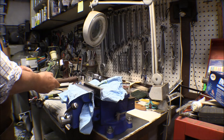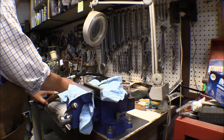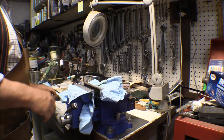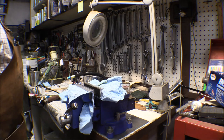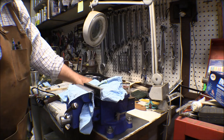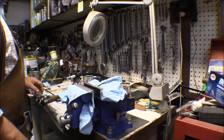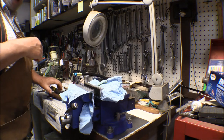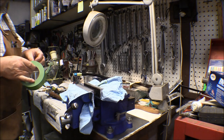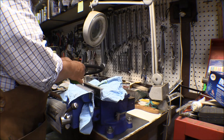First thing I'm going to do is mark up this hose. This is one hose that I want to replace and then I'm going to cut it off with a Dremel tool. The instructions say you can cut it off with a hacksaw with a real fine-tooth blade on it, but they recommend a fiber cutoff wheel. They also recommend that you wrap the hose with some masking tape several times and that helps keep it from fraying.